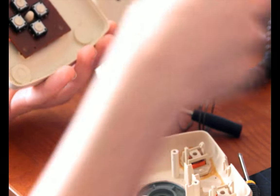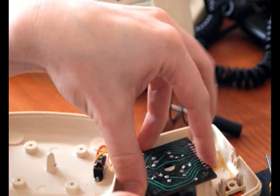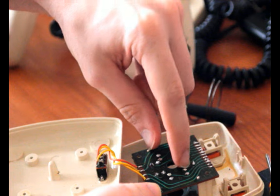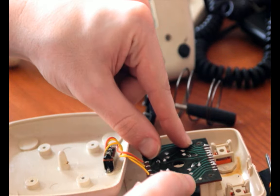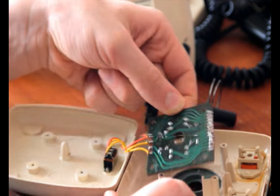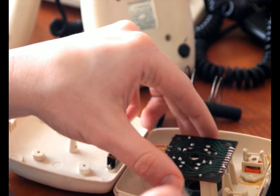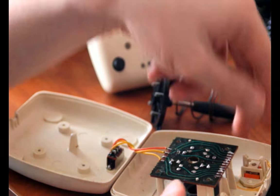But yeah, so normally the sides of the case don't push each other apart. And that's because typically this circuit board with the joystick piece under it is stuck here, and then there are usually plastic rivets here and here, on both of the plastic pegs, kind of melted flat to hold this thing down. However, I'm not sure if this one ever had them, and I just don't remember, but I know that the other two did have those. But you don't need them to put it back together. Like, it's just hard and annoying to put it back together without them.